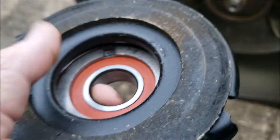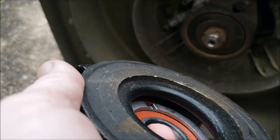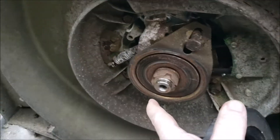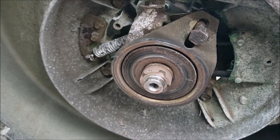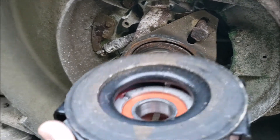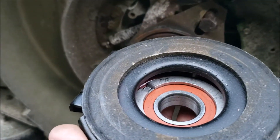I think most of these are just going to need the friction material. You probably won't have to replace the flywheel section, you probably won't have to lift the engine — all that stuff. I think this is probably a 15 or 20 minute job for most people, for these old mowers.